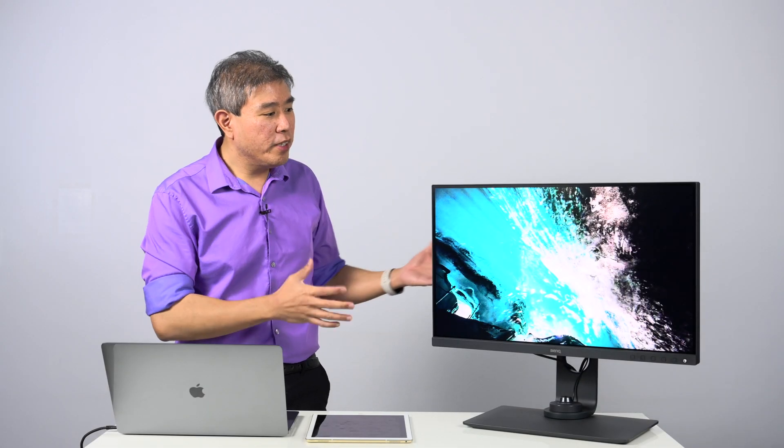The built-in color modes on your BenQ display are really there for you to approximate what that picture will look like in different color gamuts. The best thing you can do is run a custom calibration using BenQ's software called Palette Master Element — I've made multiple videos and guides on how to do this. Once you run the calibration, all the adjustments are done at the panel level, and it matches the output from your video card to the display, giving you the best color possible.